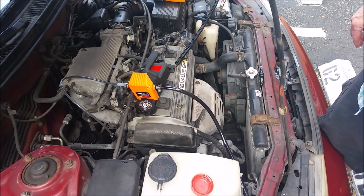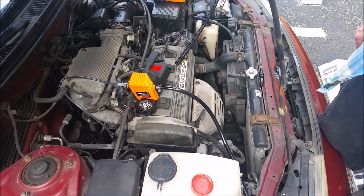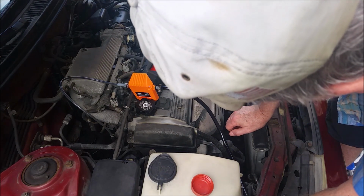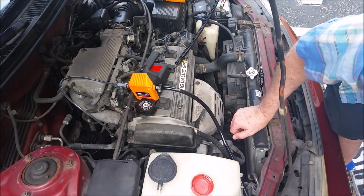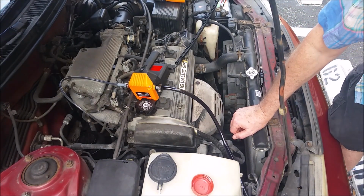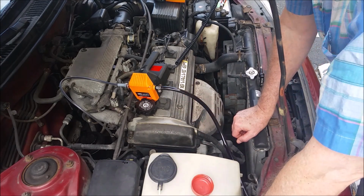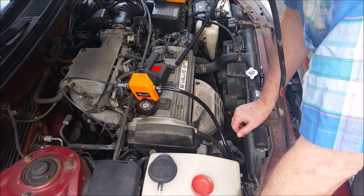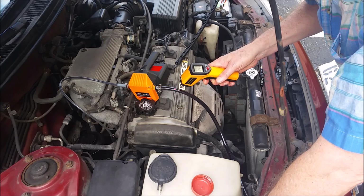You don't want to let your pump run longer than, I think it's 15 minutes. It could burn up, so you want to monitor your time when you're using your pump. I take that back. I think this particular model you can run 30 minutes before having to stop. You're not supposed to use this on water or flammable liquid, only on diesel or motor oil.